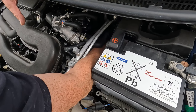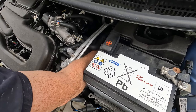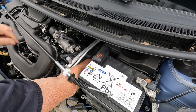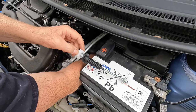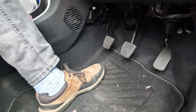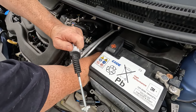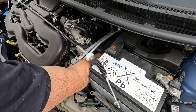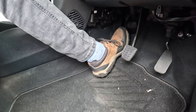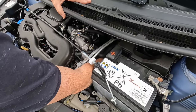Get your hand down and feel for the metal bracket. The upper two cables are the gear shift cables; underneath those, behind the bracket, you should be able to feel the white adjustment nut - it might also be black, but there will be a fluted plastic nut and you should be able to feel those flutes. When your assistant lifts the clutch pedal you can spin the adjuster: anti-clockwise lifts the pedal, clockwise lowers it. One complete turn is about six millimeters of movement. Turn it one or two turns as needed, have your assistant operate the pedal a couple of times to bed the cable back down, then readjust if still needed. It's the kind of operation you can do in 10 to 15 minutes.